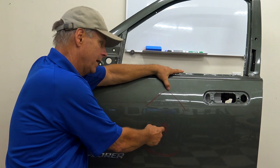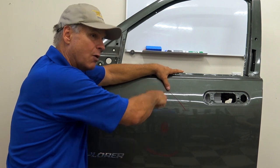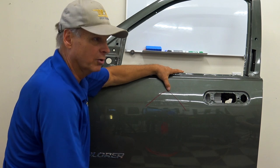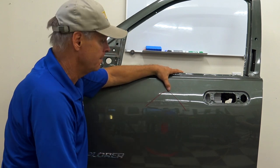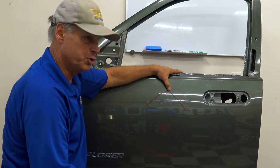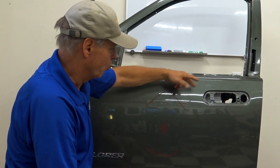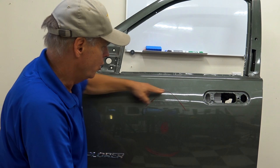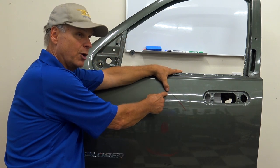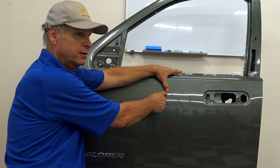You don't want to pick up on that low until that residual pressure is out of that panel and into the dent, or at least into the panel where it needs to be. We're going to talk about three types of pressure traps. Now, our residual pressure that's left, they're going to be horizontal pressure traps, and they'll run horizontal to your panel. Pay particular attention where the top of your crown was. That's where they love to hide.